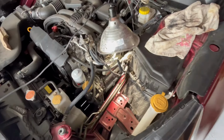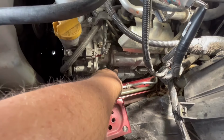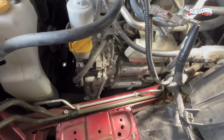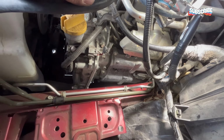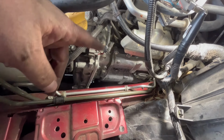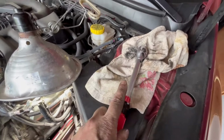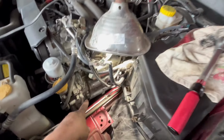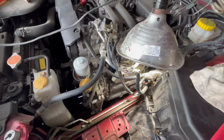All right, so everything I found on the Subaru, this is the 2.5 engine, so you want to torque to 13.3 foot-pounds. Just make sure you don't over-torque them, since these are aluminum heads. You don't want to strip them out, and then you're going to be going to very expensive repairs. So we went ahead and set the torque wrench. I can't really film it down in there, but we're going to go ahead and get that one torqued, then we'll move back to the next one.